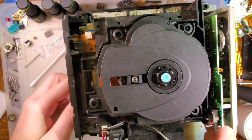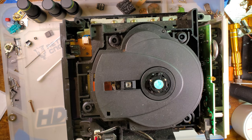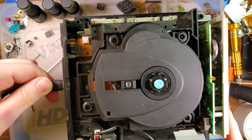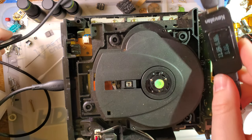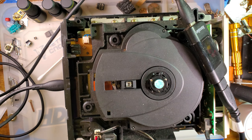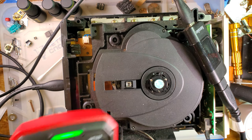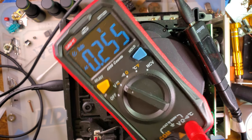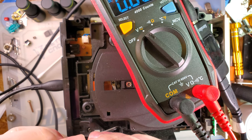Everything is good. We're going to do one more quick test before full reassembly. So the cube is switched off. I'm just paranoid that I've got this in the wrong orientation, so we're going to try it out. There is USB-C in. You can see the power supply showing 11.89 volts, which is close enough to 12, but it won't matter. Okay. Set this to voltage mode, and I'm going to stick this right in this connector here. It should be off.